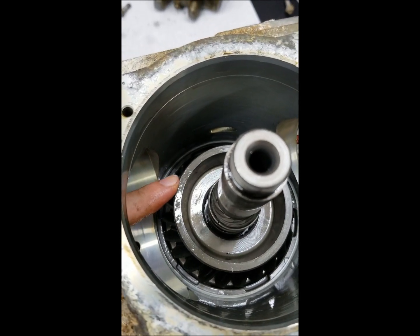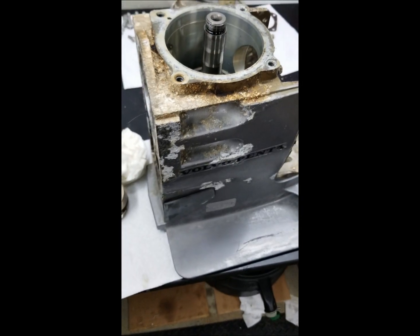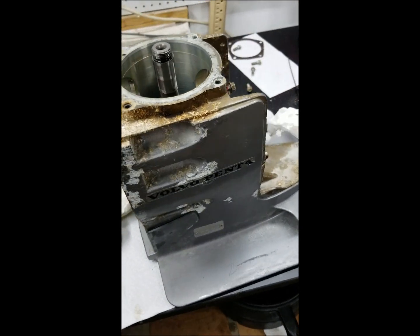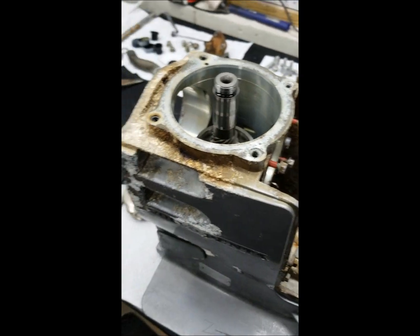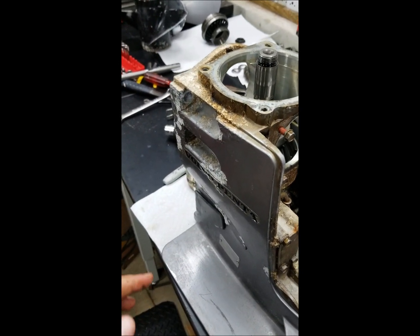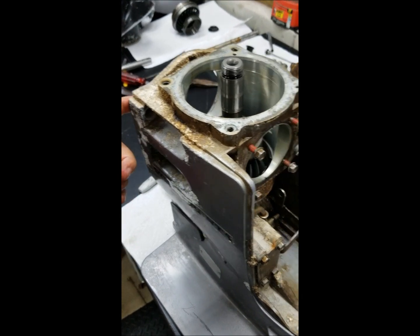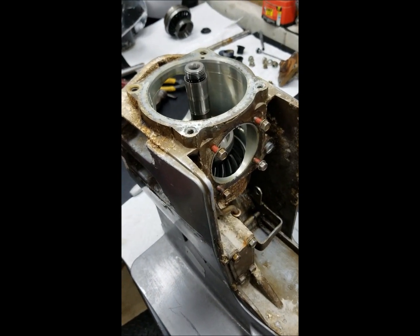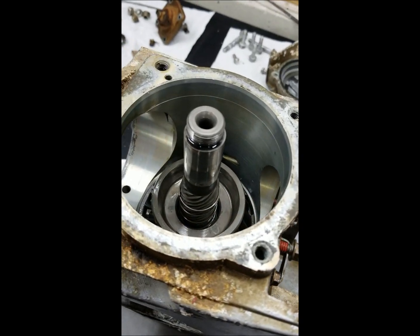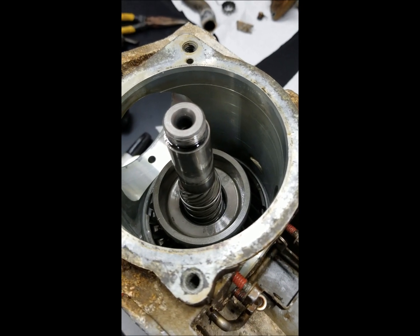But once I get that ring out, which is going to be a task in itself, I'm not exactly sure how to hold this housing while I crank on that. That's torqued to 145 foot-pounds, so that's even more. My guess is I'll probably have to hillbilly something up where I just maybe lag bolt this to a post or something to really hold it solid so that I can reef on that. We'll see. We'll figure it out. But yeah, that's where I'm at.